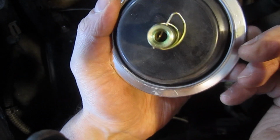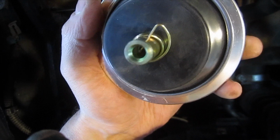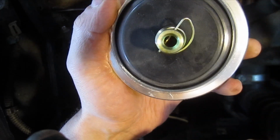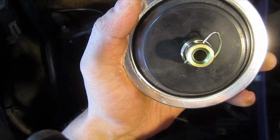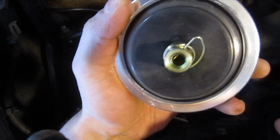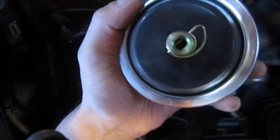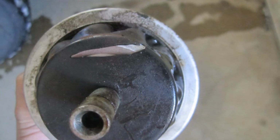And that cable, incidentally, in case you haven't seen any of the other videos, actually pulls the front differential into a lock state. So sometimes your transfer case could be locked in, so the vehicle thinks it's in 4-wheel drive, but your front differential is not locked in, so you don't have 4-wheel drive. Alright, let's go ahead and get this installed.